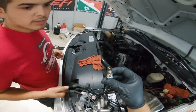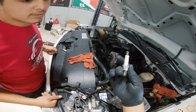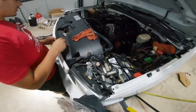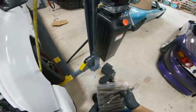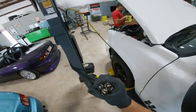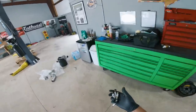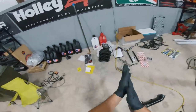We were only spraying a 175-shot and the TR6 plugs are perfect for that. The new nitrous kit will be different and won't need those TR6s, but they'll be fine for now. The plugs really don't look bad — perfect coloration, just a little oil on them, which is no problem. We're going to wrap it up for today since we definitely need new plug wires before going further.